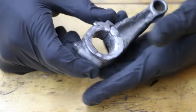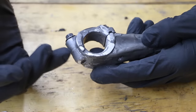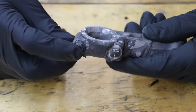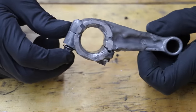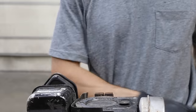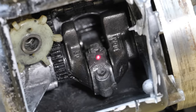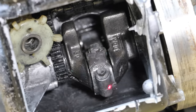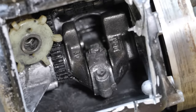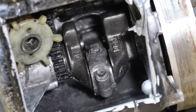Whenever this connecting rod disintegrated, it actually bent some of this cast aluminum, making it virtually impossible to repair. But here's one more look at it. You can see the connecting rod cap, the bolt that I used that's a little bit longer than the stock bolt, as well as the bottom end of the connecting rod, and up where the piston meets the top end of the connecting rod. There's just not nearly as much movement as there was before, so this is a little bit tighter. There's still a little bit of rattle in there, but not very much.